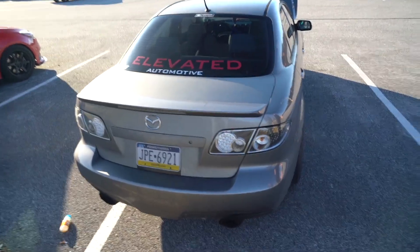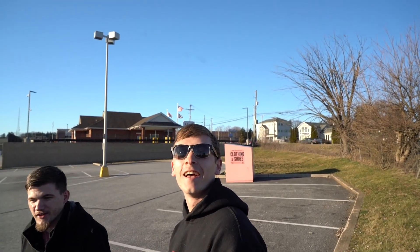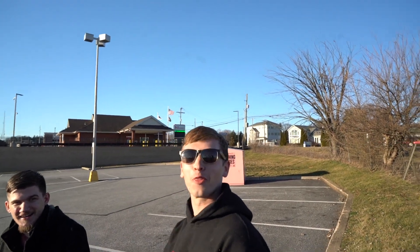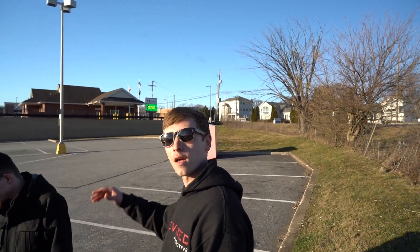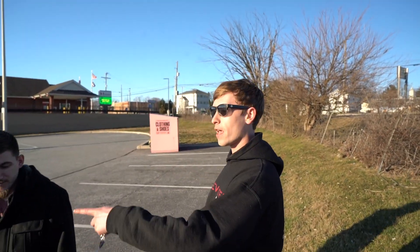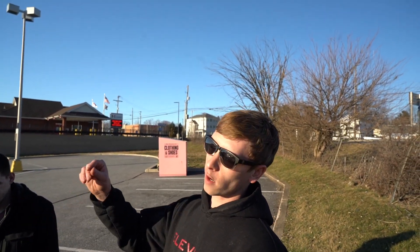I love the car — I beat Mike two out of three times. I missed fifth, that's the only time he beat me. We did a third-gear pull and a fourth-gear pull, she shot right to 20 PSI and he was gone. Around 6k I get more boost and fuel, but I'm still running a stock fuel system, so it starts to sputter like I'm blowing out a spark plug. I just keep letting off at 6k, but I still had him running 22-23 PSI.